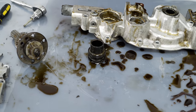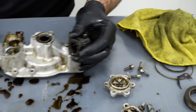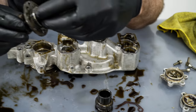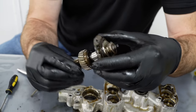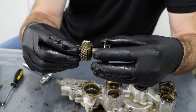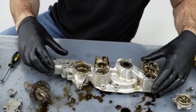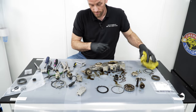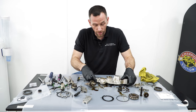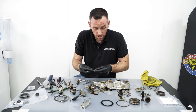So is that the other piston? This is the other piston, slightly different design to that side, but it works basically the same way. Oil pressure runs on the back of it to force the piston in or out. It does exactly the same job, both sides. At that point, is the unit fully stripped down, isn't it? Pretty much. There is just the VANOS filter to take out, which we'll always take out for washing.